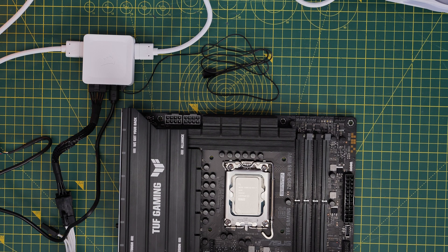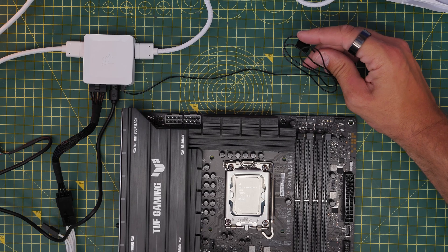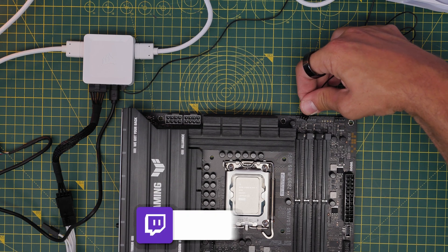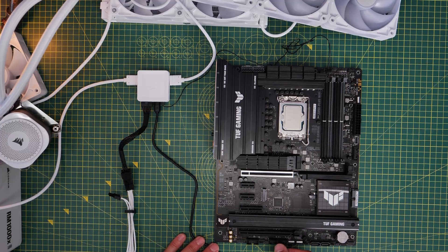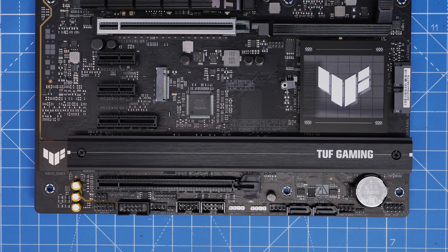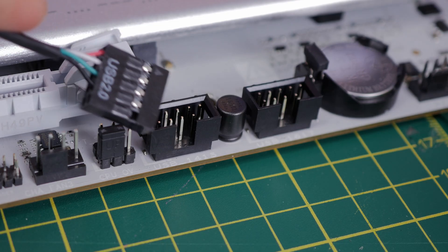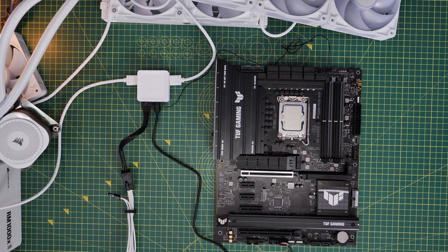You might need a larger wattage power supply if yours doesn't have enough cables. For the motherboard connections, there's a tiny cable you can use to connect to either the AIO pump header or the CPU fan header. Motherboard BIOS will often complain if nothing is connected to the CPU fan header, so I generally recommend connecting to that. The other connection is the USB connection, which connects to the internal USB header at the bottom of the motherboard — refer to your manual if you're not sure. All three cables need to be plugged in: two to the motherboard and one to the power supply unit.